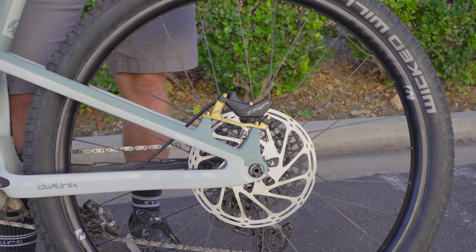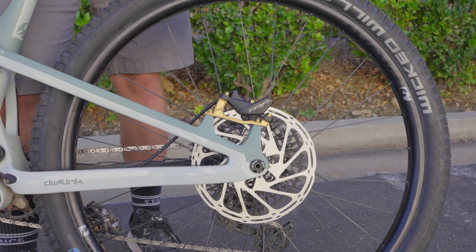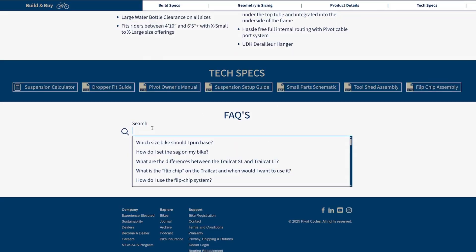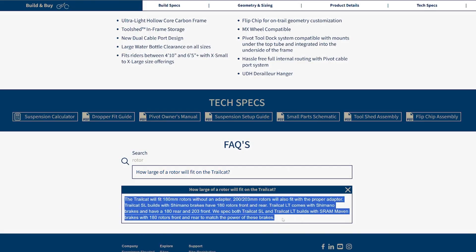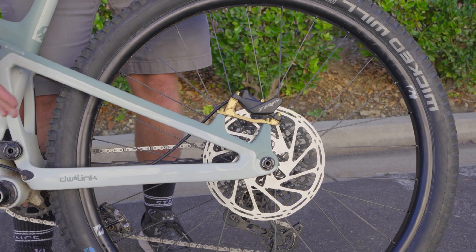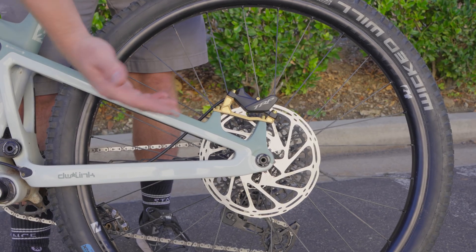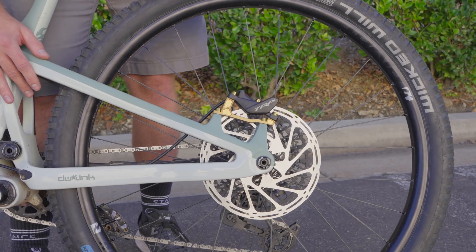Next, let's cover how to find the minimum rotor size for your frame. This can be a little bit more tricky, but it is usually found somewhere on your frame's product page from the manufacturer. Do make sure to find the product page for your specific bike model and year, as sometimes this does change depending on different bike models and years. If you're struggling to find this information on the manufacturer's website, there are a few other ways to find minimum rotor size. For example, if your brake is mounted to the frame with no brake adapters at all, your minimum rotor size is just the current rotor size that you're running. If you do have a brake adapter installed, check the brake adapter to see if there are any markings telling you what size it is. From there, you can use the same math we previously discussed to reverse engineer your rotor size and figure out what minimum rotor size you would be able to run on your bike.